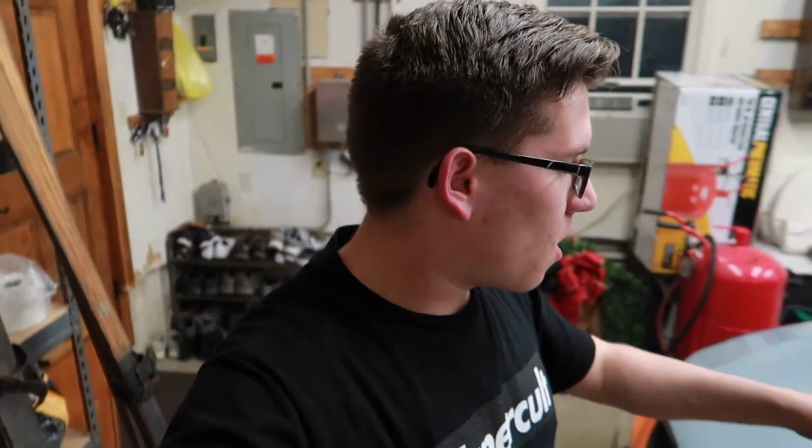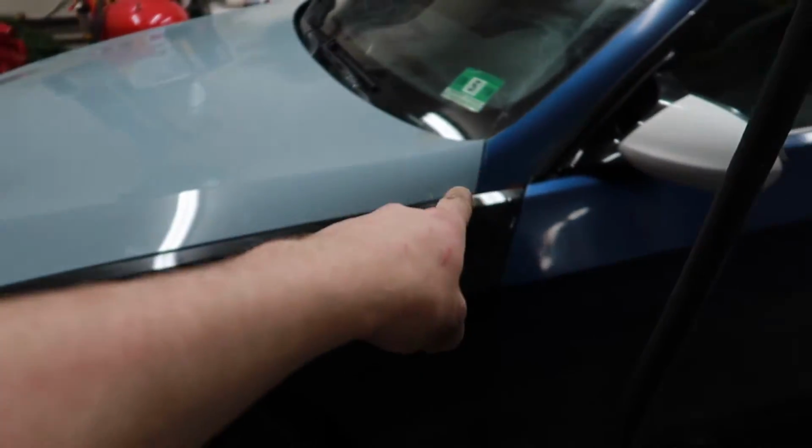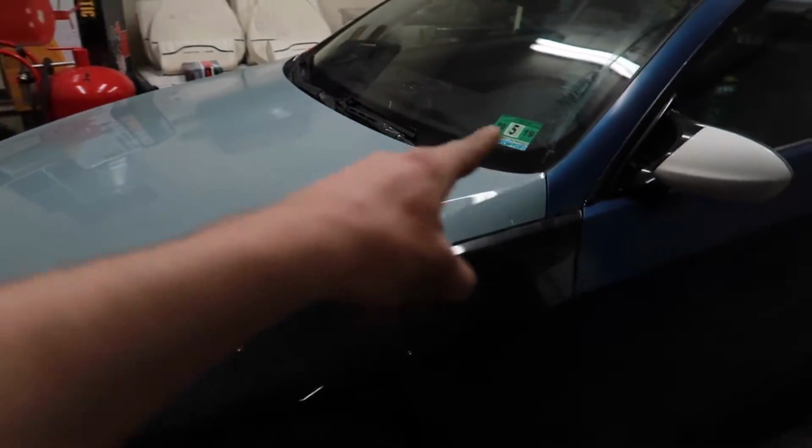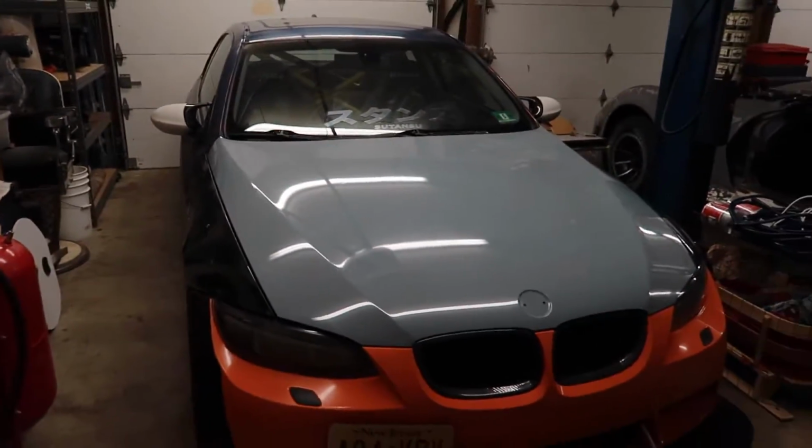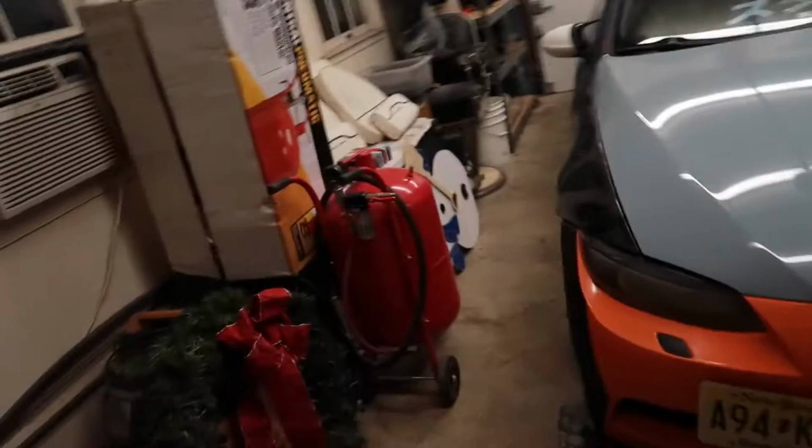Little did I know, my hinges were bent up a little bit. They're not too bent, obviously. I got them to work. But when I was putting everything together, that panel gap right there, hood to pillar, and same over there, I was getting zero gap at all. It was just making constant contact. I chipped up the primer a little bit on that corner, but that's nothing a little glazing putty can't fix. But I got my body lines good. Everything fits really good. I'm really happy with how it came out, but that took me like an hour and a half to do.